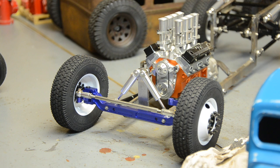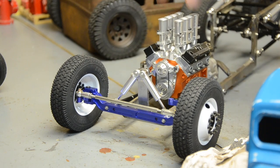It's gonna be mounted in the grill, and the shocks with a cantilever setup would have been all kinds of in the way and up under the headers, and it would have eaten up too much valuable space. So I opted to do this style like I did on the farm truck. It's a lot cleaner. I just used some flat bar stock, 1/4 inch thick, welded an upside down T and welded it to the frame. It also acts as a front cross member, so now the frame is completely rigid from front to back. Welded cross member, motor mount, welded cross member, and we have our bolt on cross members on the rear. So it's pretty straight, pretty rigid. I'm happy with it. And I may have to add some springs.